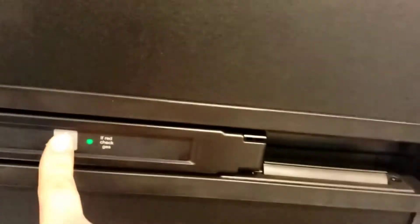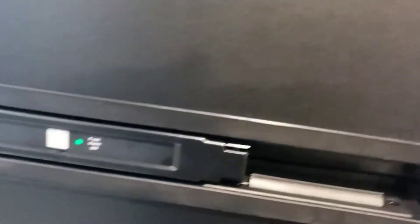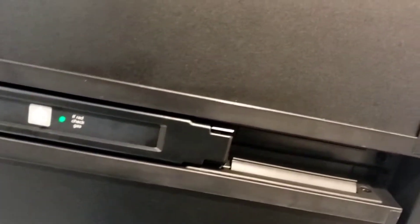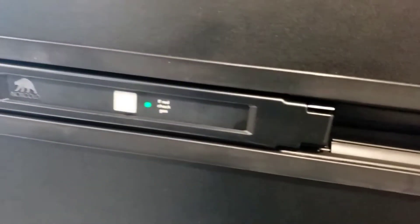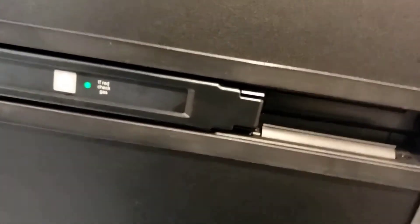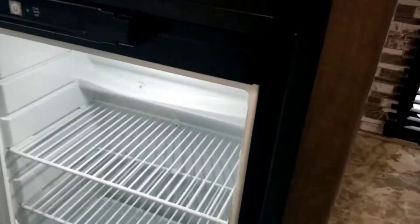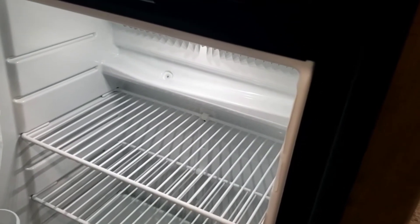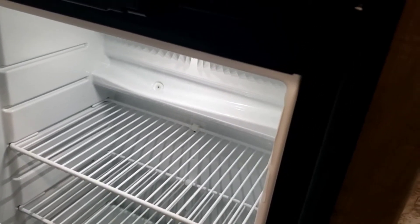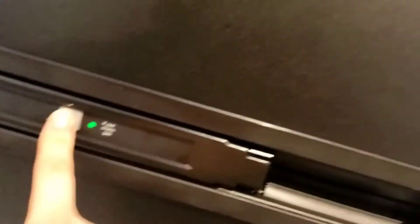Your fridge is super simple — on or off, and its only mode is automatic. It's automatically going to default to 110 volts. If you lose power or get unplugged, it's going to automatically switch to running off propane if your gas is on. Unlike your fridge at home or the outside mini fridge, this works differently — it'll take about 8 to 10 hours to get to operating temperature, maybe longer if it's super hot outside.